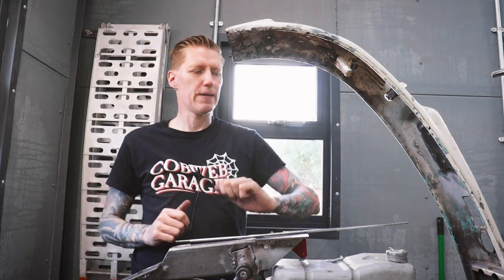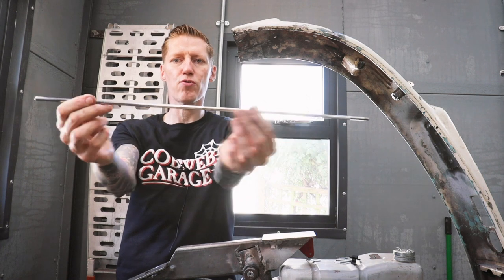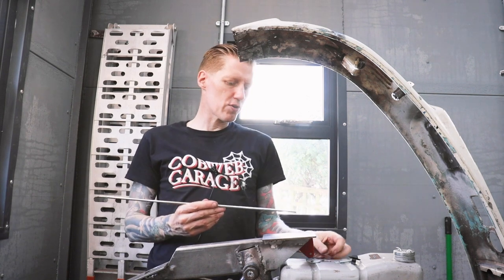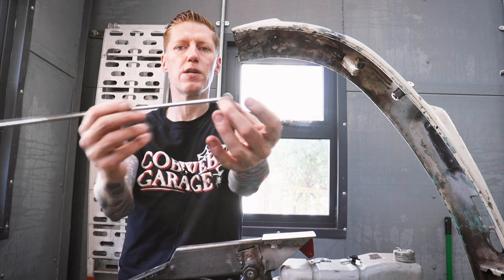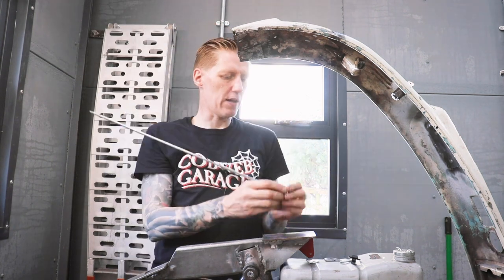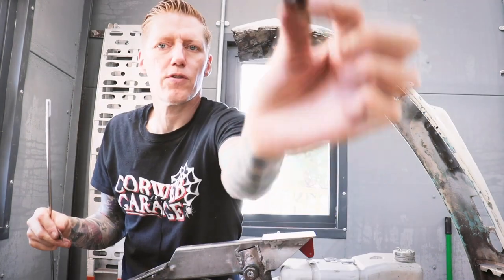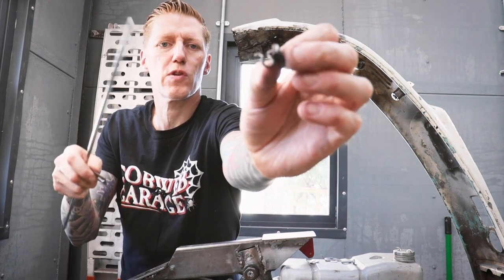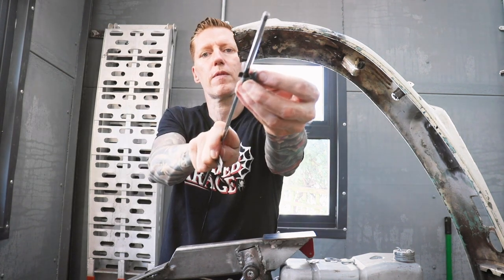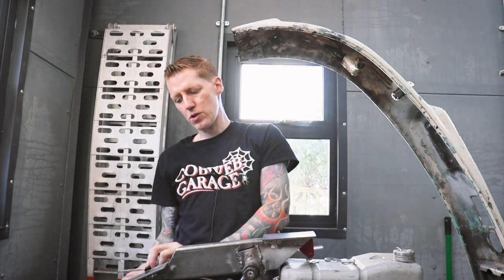Thinking I need some kind of stay, a bit like they have on a bonnet, just to keep it up. So I've got a bar, which is actually from a drummer's hi-hat stand. I've got a bracket here, which I'm going to weld about there on the scooter. I'm going to weld a washer to the hi-hat stand bar so that it can pivot up. Then I'll put a bolt on the loop, so another washer on the other end of this can just hook onto that. I've got this little bonnet stay keep, if you like. Hope you can see that. That clips into there. And then I'm just going to weld. I've made a bracket to hold the keep, and that will just weld on the back there.